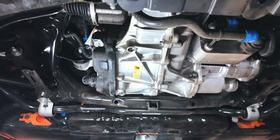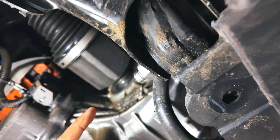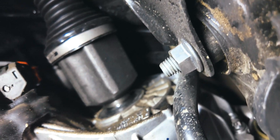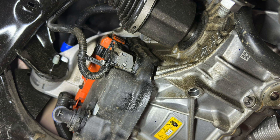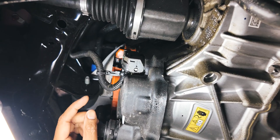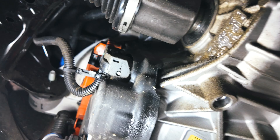On the driver's side — the US driver's side — half shaft, you can see a lot of residue and buildup here. Ours has currently attracted some dirt to it, but this is all oil residue. You can see some oil residue here, and then check it out all up here — all the electrical stuff — you can see oil residue deposits all over. It's just been slinging around everywhere.